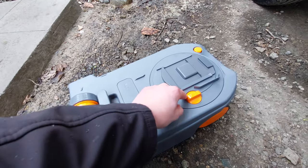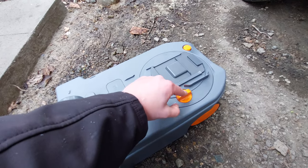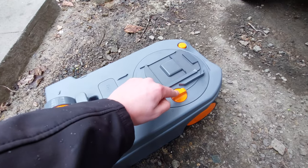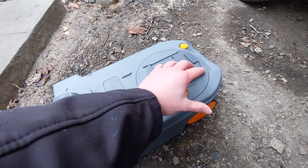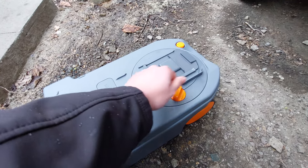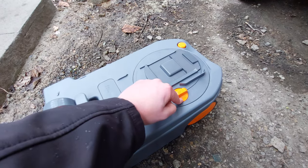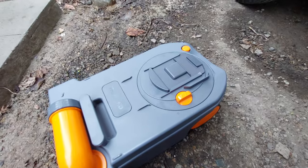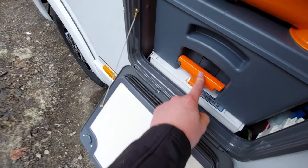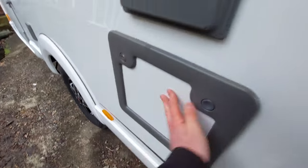You'll notice there's a little valve here — like a little switch. This should always stay in this position; there's no need for you to turn or move this. This is what makes contact with the blade and allows you to open and close the cassette. If it's off slightly, when you go to pop the cassette back in, it will get jammed. Ensure it's always in that position. Once ready, slide the cassette back in — once this little orange handle is clipped in, it's ready for transit.